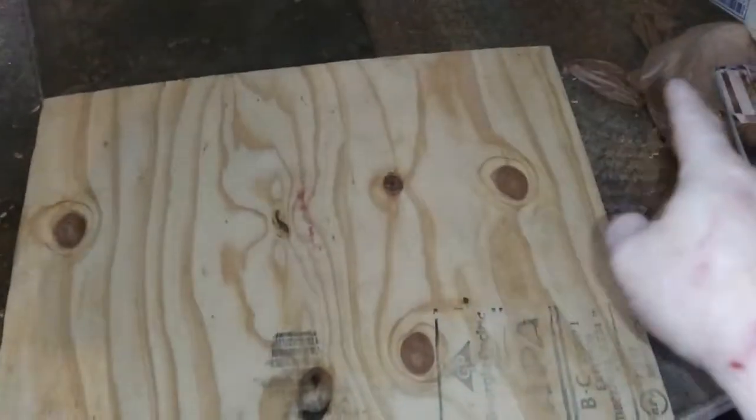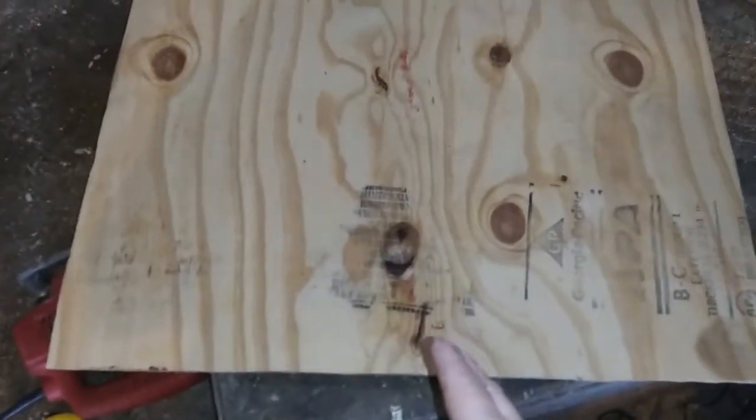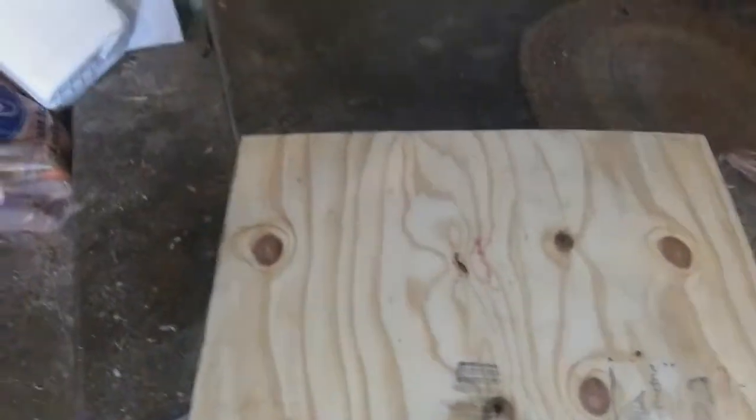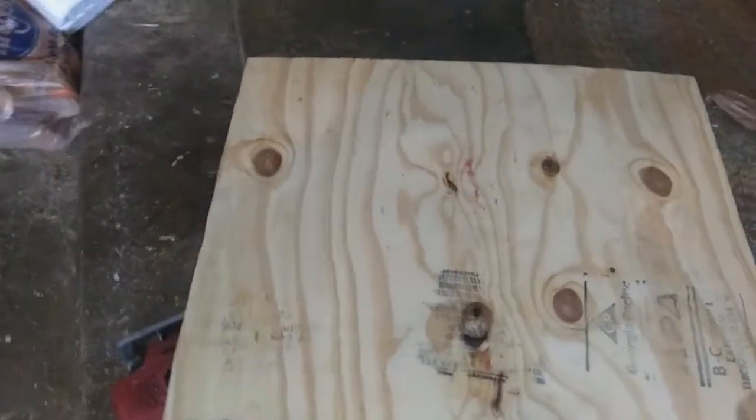On the back side of this board it's going to be framed all the way around, so this will be a one-piece panel with wood framing around the access door inside. This will take the place of the interior paneling — it's a little stronger and stiffer than interior paneling — and the grain of the wood runs upward so it'll really be supportive in an upward direction.